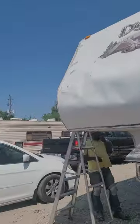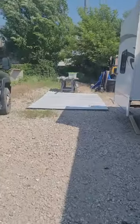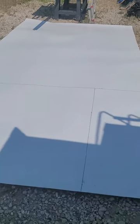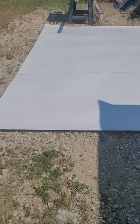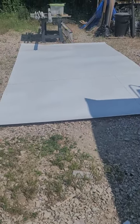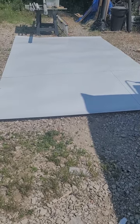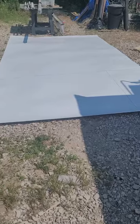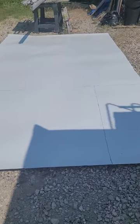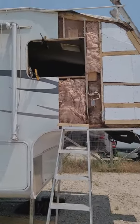We've already made our measurement for the first side. The fiberglass comes in a roll of sheeting like this, and you just cut your size out. Then it has to be put up there and drawn out like a template, then you can cut it out, PL it on, install your new trims, and you have a brand new front end of a trailer.